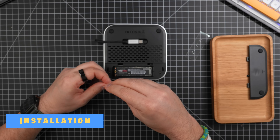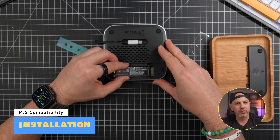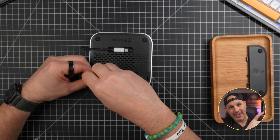This is where the real magic happens — installing the M.2 drive. All you do is open up the storage port to expose where the drive goes, apply the thermal pad and insert your SSD at a 30-degree angle, tighten the one screw, close it up and that's it. You've got an instant storage upgrade without Apple's ridiculous pricing.